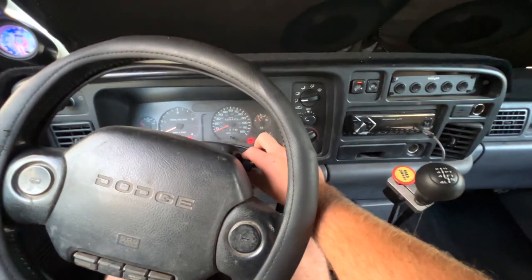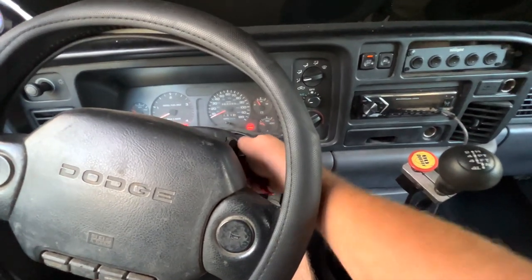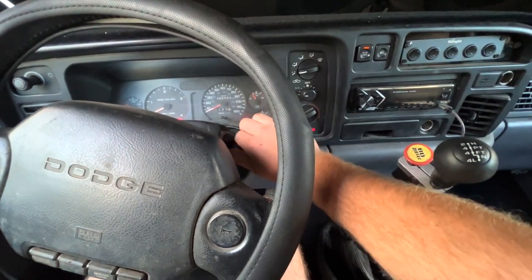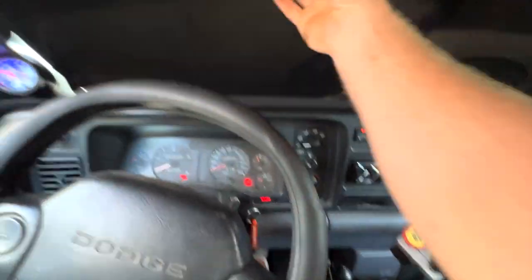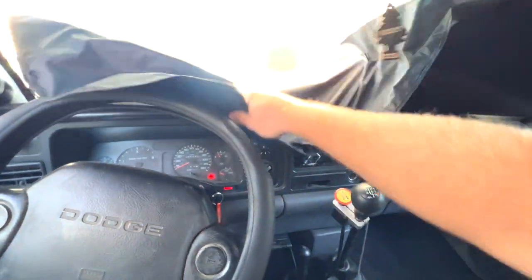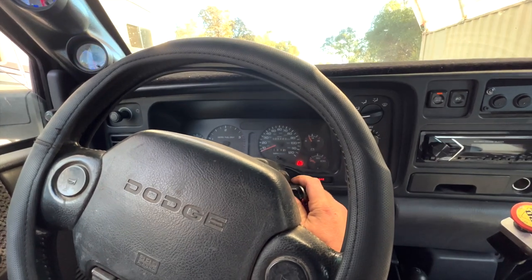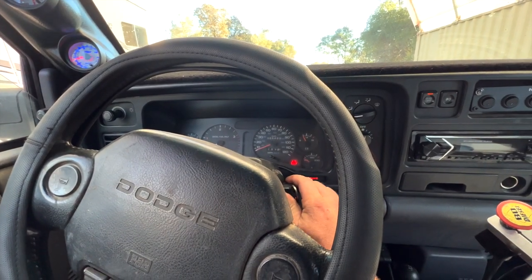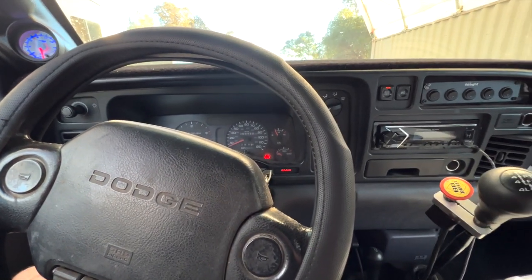Sometimes it cranks just fine, sometimes it won't. You've got to go underneath with your Leatherman and give it a janky jank. It's not a foot pedal thing because I disconnected that at one point too. I think I might have an idea what it could be — we'll get down to the shop. This truck was actually a factory automatic, so either the wire going down to trigger the starter has corruption midline, or the park or neutral safety switch wire has come loose.